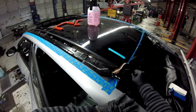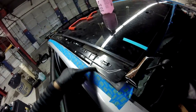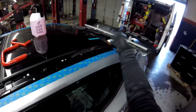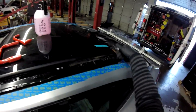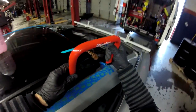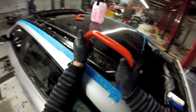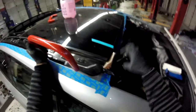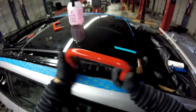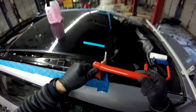You can see the glass lifting. There you go. Okay, so now I'm going to pass my cold knife over here and make the cut. Remember, this one has to be replaced, so don't worry, you bend it, not too much of course, but opening like this is already deforming the frame, but it's going to be replaced with a new one. So I'm going to put my cut knife going in this direction, like this, and making the cut like that. So every time you're cutting, you're pumping. If you have to retract and run another size, it's the same process.